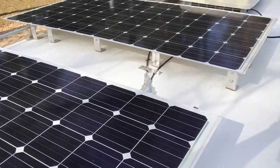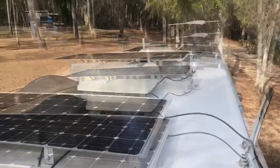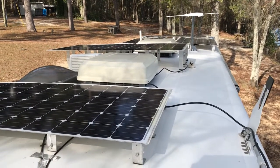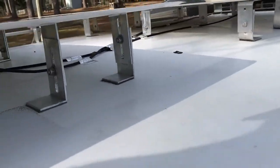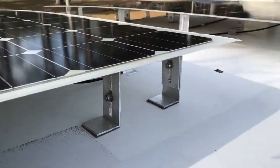There's a total of six panels on the roof for a total of 1920 watts. These are semi-flexible panels, so you'll see a little bit of curve on them because they're frameless. They're attached solely with VHB tape and brackets that I designed myself that fit on the curvature of the roof.